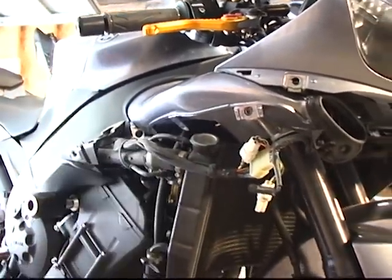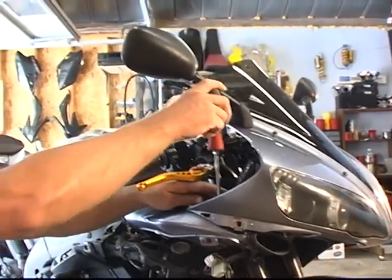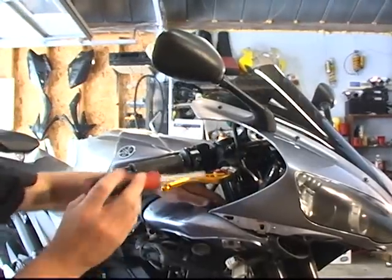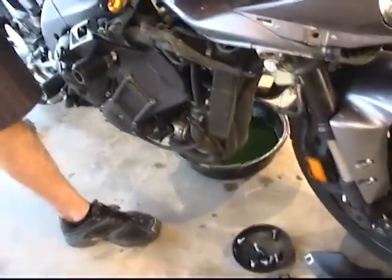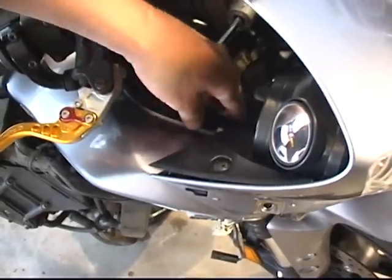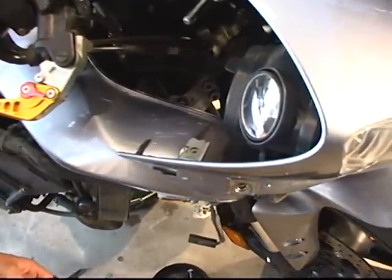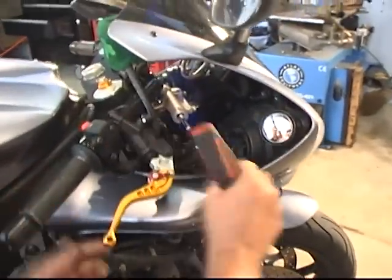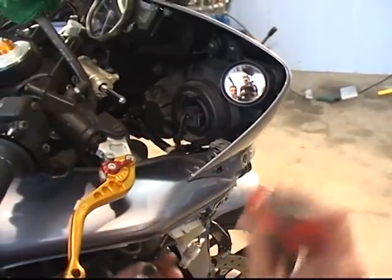That's going to remove our inner cowling. For the tube at the top there's going to be a screw at the top and a pop rivet on the back side of the tube — just press down and gently lift up, it comes right out. So there's a pop rivet and a screw. Next, another pop rivet right here in the front of the ram air tube — just press it in, a little shake, and they come right out. Very easy. Don't manhandle those or you'll break them.